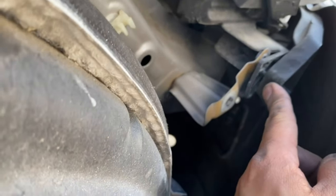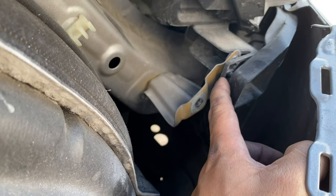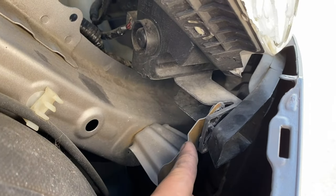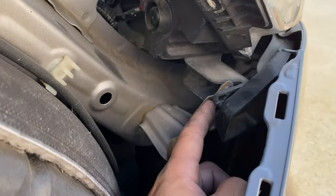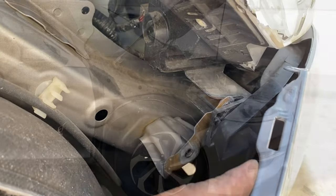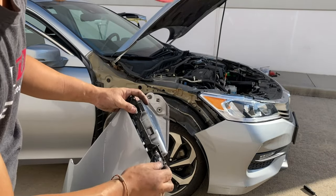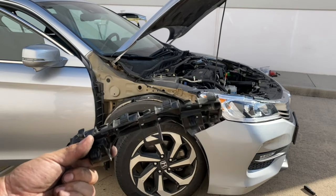So you guys can see right here this bracket. You have two brackets — this bracket right here is attached to the fender, and this one is going to be attached to the headlight. This is the body of the car. So when you guys wedge the new fender in, you got to put it really on top of this metal bracket right here. If you put it in this slot, it won't work. So you got to push it in here. All I did on this one is just kind of pull back like this and it released this fender. So the next step is to go ahead and take this bracket off — it's just a Phillips screw right here, two of them. From behind, all I did was pinch this so it releases it.